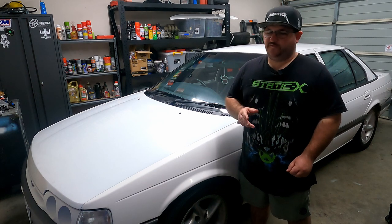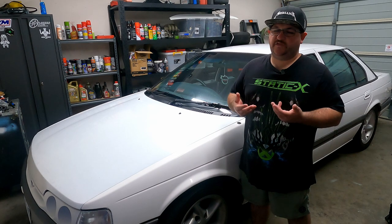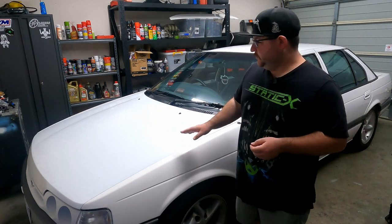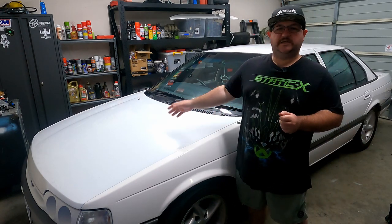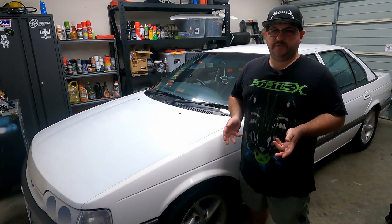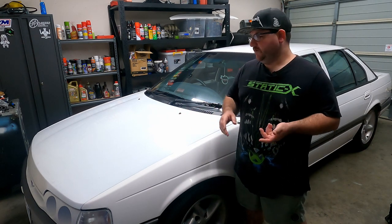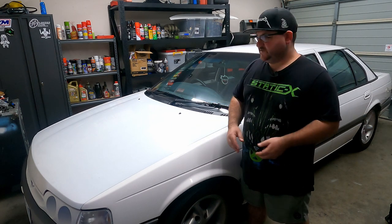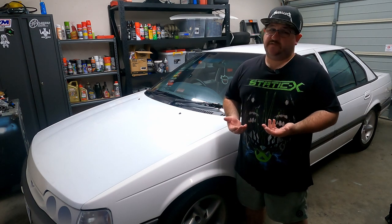If you've been watching my channel for a while, you'd know that this car previously had a red top and that made 330 kilowatts. So even though the engine didn't make as much power as I thought it would, being a green top, having more compression, I was expecting a bit more power, but yeah, the turbo is just holding me back. Even though it didn't make what I thought it would, it wasn't a complete waste of time because this is the first engine I have ever reassembled myself. You know, new bearings, did the rings, all new bolts and gaskets and all that stuff. It lasted on the dyno and nothing major happened. So to me, that's a win.